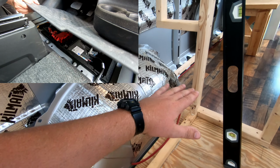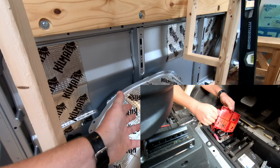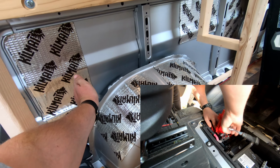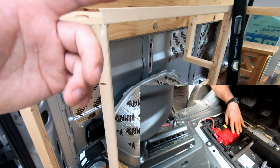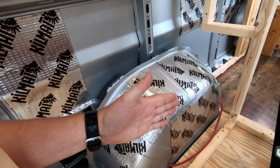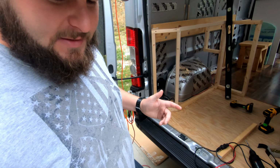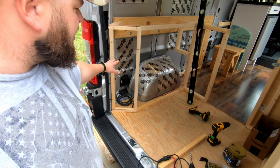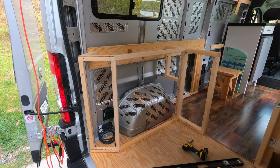And now I want to be able to cram up to 4 of those batteries in here, or any battery. So this bank is actually going to be modular and be about out to here. I'm only going to put 2 in to start, see how the system runs with the solar and the alternator, but have the capacity to come up to number 3 and number 4 batteries right over here. So that's next up. Frame that solution out, get a backing board over here for distribution for the solar charge controller, all the fuses, and we'll get you up to date. Let's do it.